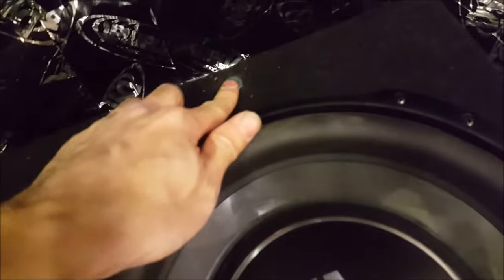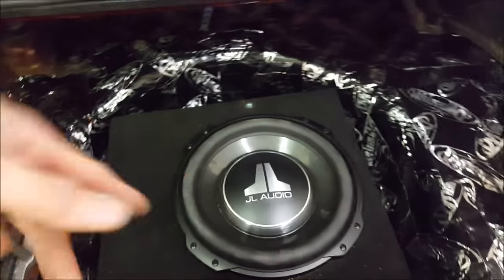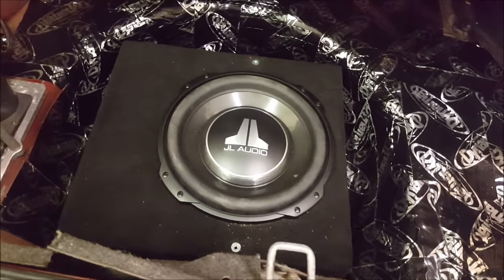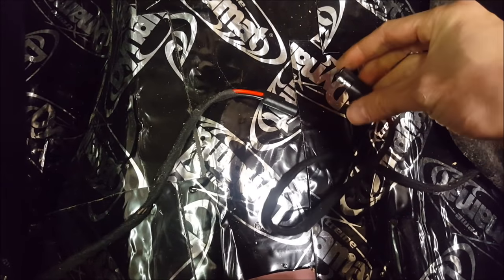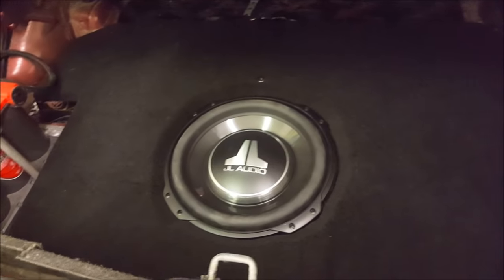For serviceability I added threaded inserts into the enclosure and pre-drilled it onto the beauty trim, so you'll just be able to install these allen-head bolts. They'll be black so they hopefully blend in with the rest of the carpeting, and if you ever need to pull this out for any reason you just undo the bolts. Over here I used a trailer-type connector because we're only pushing about 400 watts — this connection can easily handle that wattage from the amplifier to the enclosure. You just quickly disconnect it and pull the enclosure out. The nice thing is it's dummy-proof — you can't wire up the sub backwards as long as you plug it in.